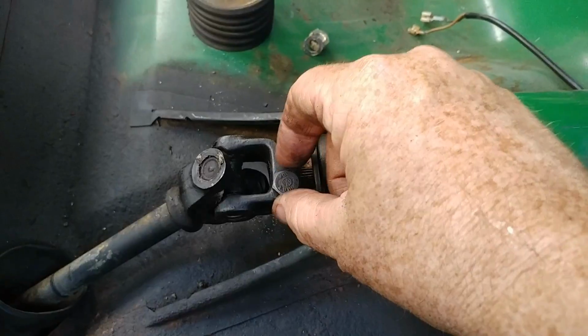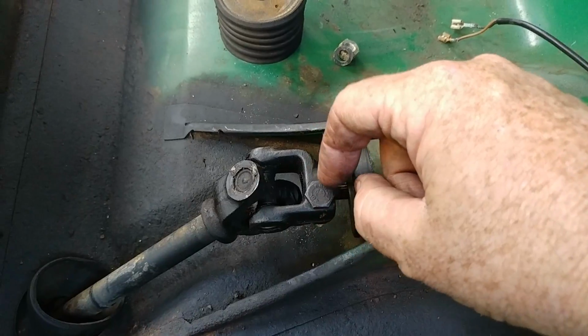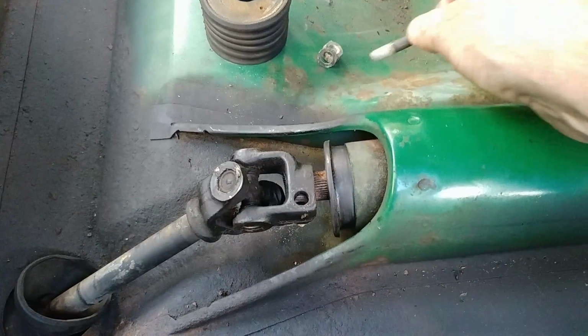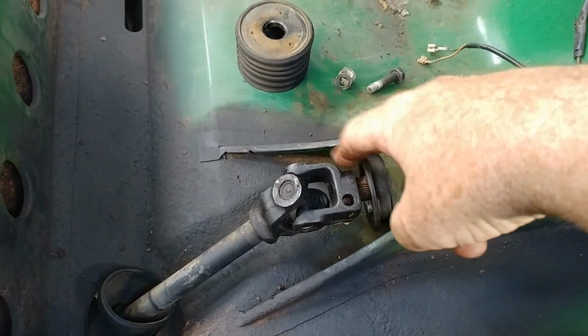Again, you take two 14 millimeter wrenches, like I just showed you on the ground over there. So once you redo this, you go inside the car, and there's going to be where you can see the hole right there. That's where the two 13 millimeter sockets are at. You just undo those two sockets and the whole entire steering wheel is free. Then you just come back out here and you just take a hammer and you just tap.